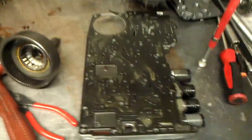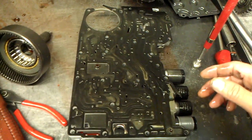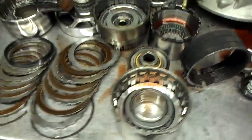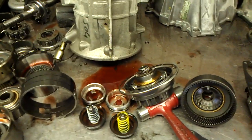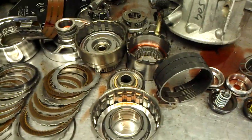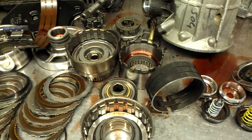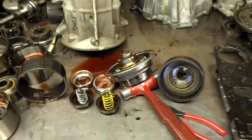So with that being said, don't just replace your valve body gasket. You can do that to get a couple more miles out of it, but basically this transmission is worn out. This is a 2000 Ford Explorer 5R55E, rear wheel drive. There you have it — 5R55E with no second gear. I did not have a code for second gear; it was flaring in third and sometimes skipping third with the P0733.